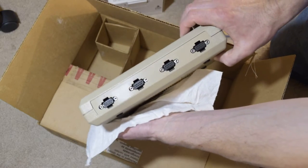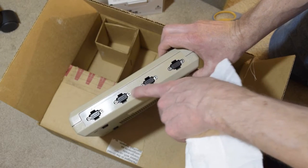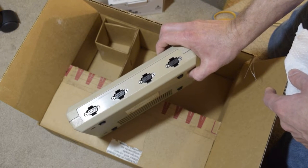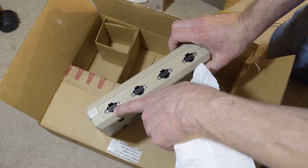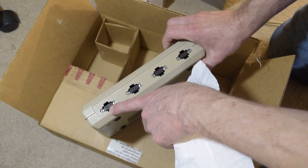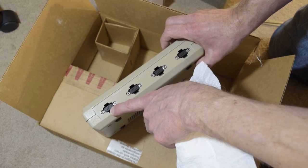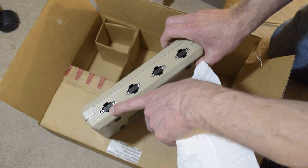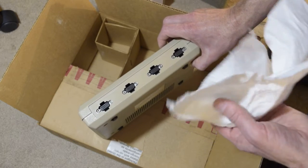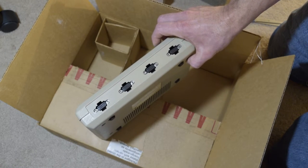Here on the back there are four serial ports. Port one is the main one — you really want to use port one. Ports two and three have less handshaking for modems. Port four was interesting — in the eighties, you could connect a terminal unit hooked up to a ham radio shortwave receiver to the Atari 850 to receive current news over the AP news networks from around the globe, since signals bounce off the ionosphere.